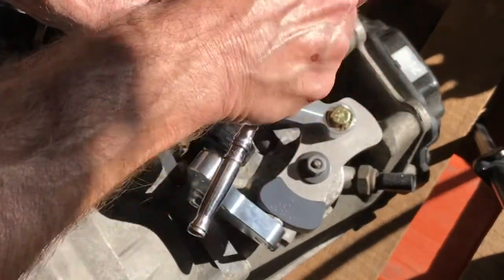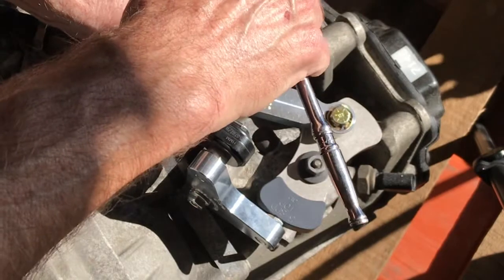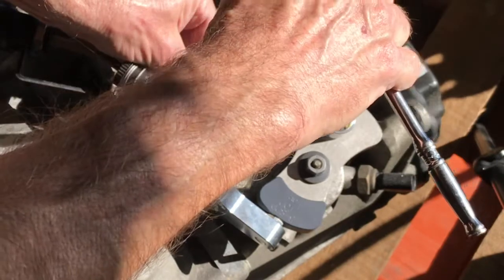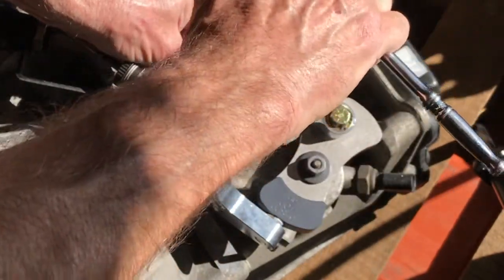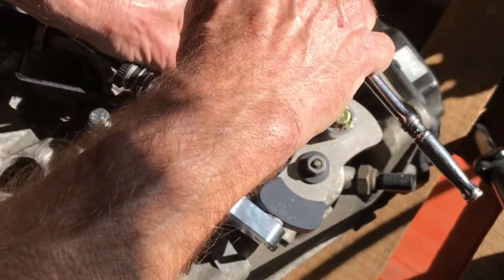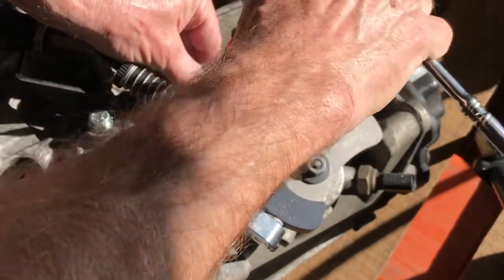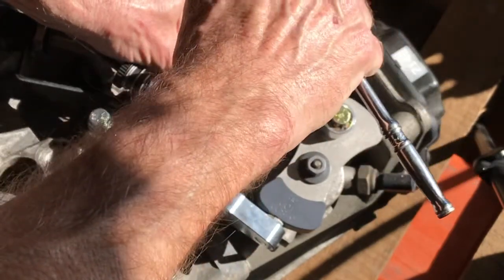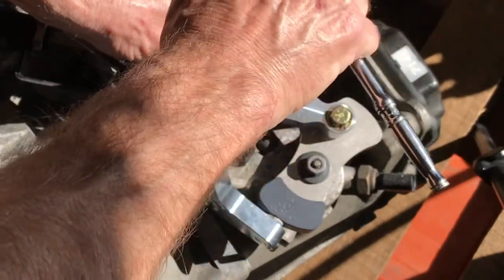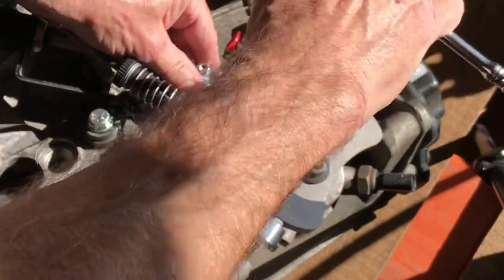That's kind of a unique attribute of the nut bar, is you get just a little bit of a turn at a time, and you go back and forth several times in order to get the clamp tight on the cable. Once you go back and forth several times, you'll notice that the screws get a little bit harder to turn, and once you get it pretty close to fully tight, it'll kind of tell you that it's done. Since you don't have to hold anything, you can just put the wrench in and turn it just a little bit.